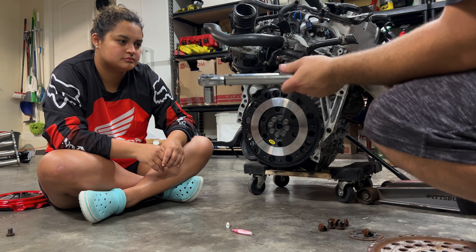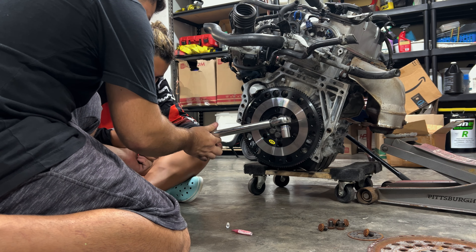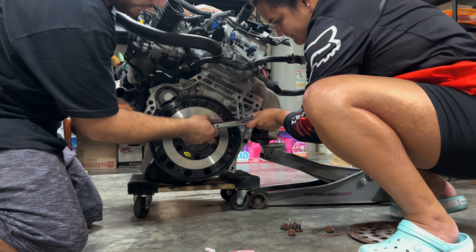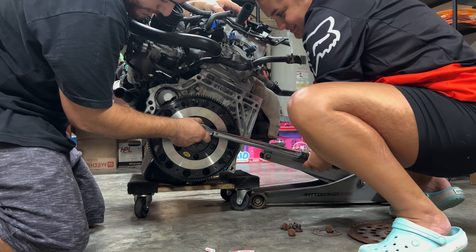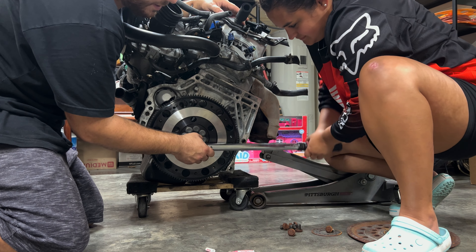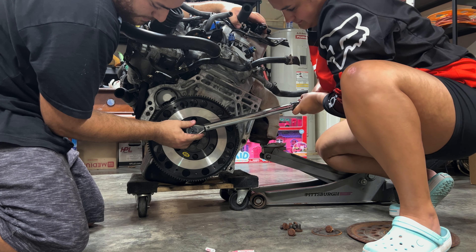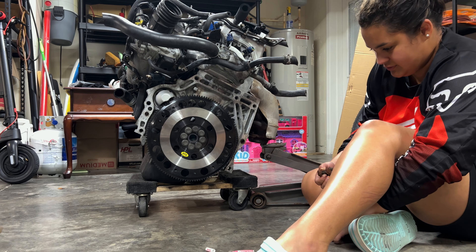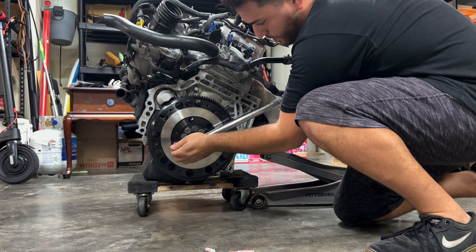Set it to the 60-pound line - it's locked right there. To unlock, you twist this left and push it up to the number you want. Pull this up so you get leverage, then push down. We got that one to 60 - that's why you need more leverage. Now we have to go up to 90 foot-pounds. I'm going to do this one since it's a bit tighter. Anything that has friction - be it brake pads or clutch kits - you can't have grease on it. It has factory oil and you need to wash that off with brake cleaner or alcohol just to take that film off. They put the oil there so it doesn't rust, but it needs to be taken off.